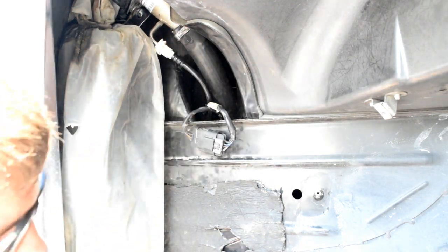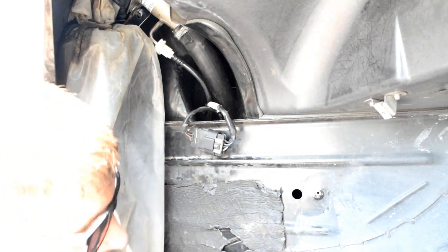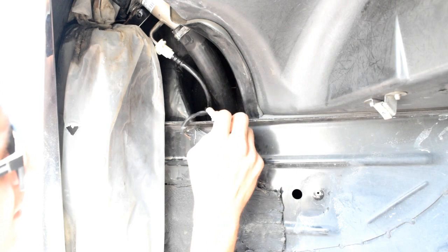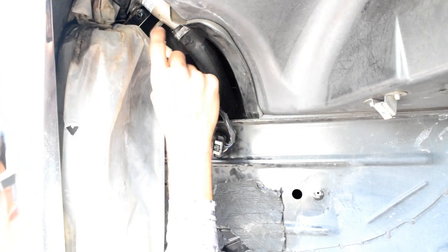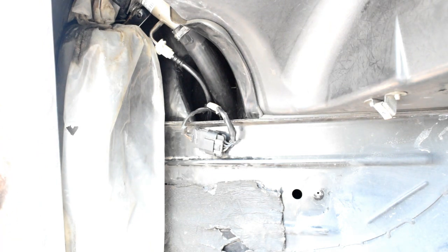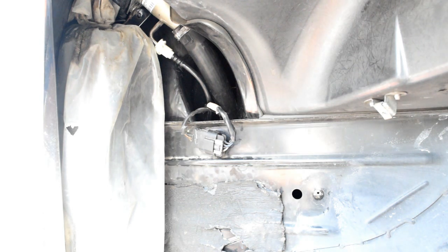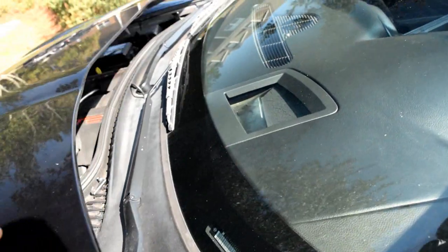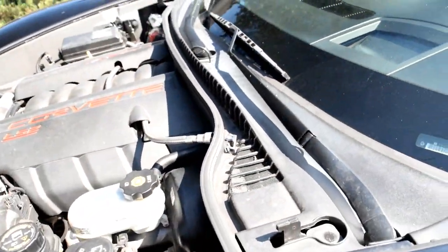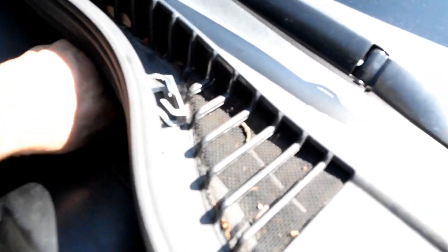How nasty. Okay, so now the fuel tank is kind of floating in place, held in place nicely with the filler tube. I've got the two evap lines connected, the one here, the one under, and the electrical. Now, I've got to do that crossover tube, and that's gonna be kind of tricky. I'll try and get the camera under there with me. And before I do that, I might as well come back over here and reconnect this fuel line. Get it nice and snug.